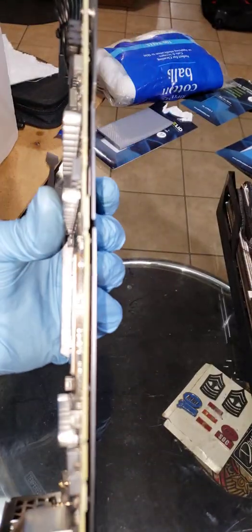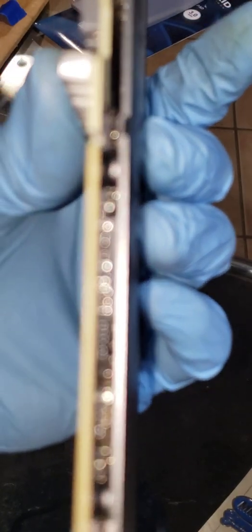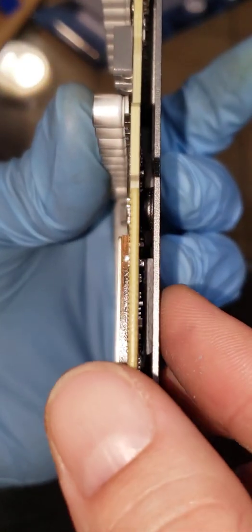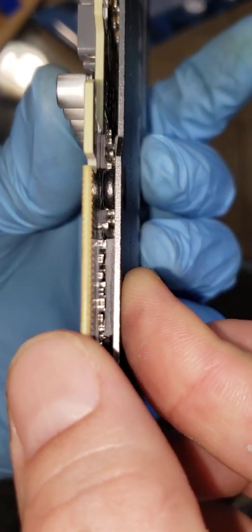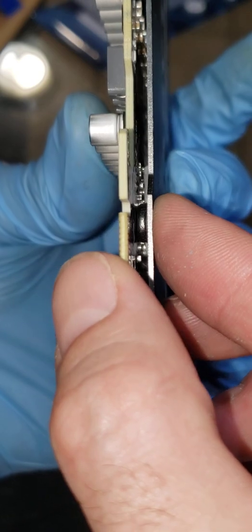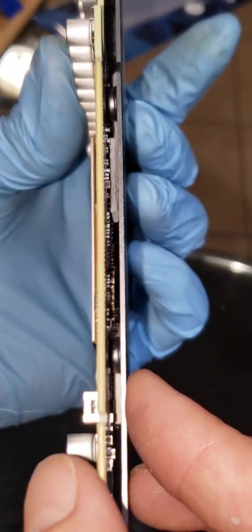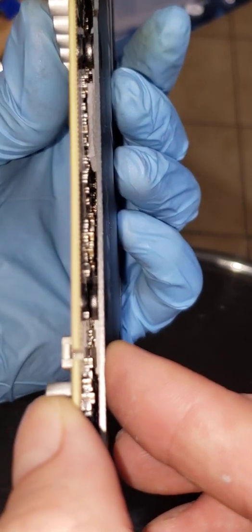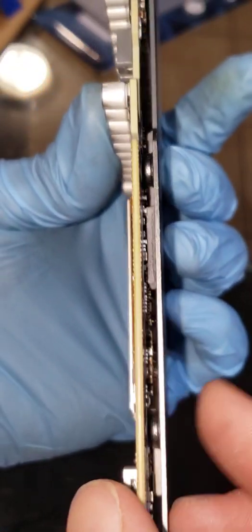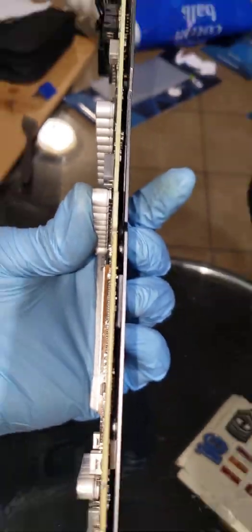If we take a close look at the gap, you'll see that this 2mm pad — if it were any thicker I don't know how the screws would close down. For those of you using 3mm pads: how? There's barely any space in there. But 2mm is perfect — it's going to allow you to screw all the way down just like you're supposed to.